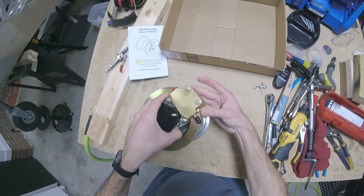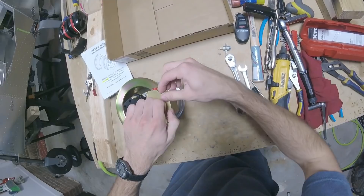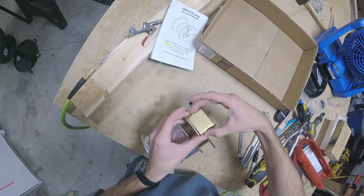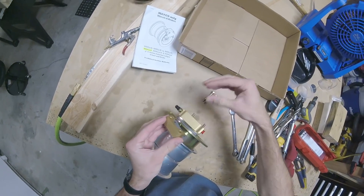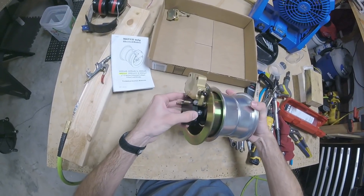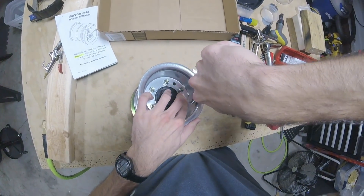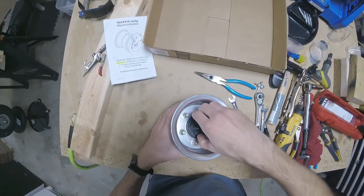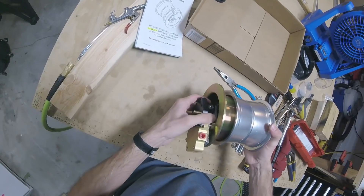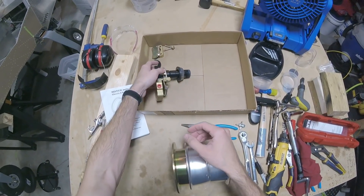The first thing I'm going to do is take off this caliper right here, which takes a 7/16 inch wrench. We've got this spacer right here — set those aside. Now we've got this guy still connected, so we're going to pull out this cotter pin, take off this nut, and the axle will slide out. We've got one bearing in the axle and the whole brake assembly there.